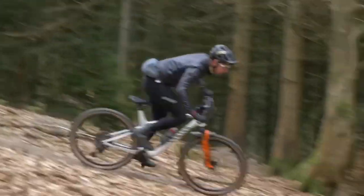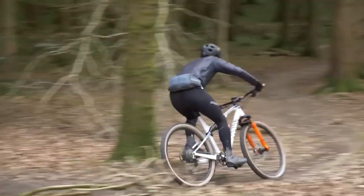In winter you ride slower and it's all about getting your tire to conform over mud. I find anything from 27 up to 30 psi is a pretty good range for that tire — there's enough support so it doesn't roll around too much and it holds its shape well. Something people don't discuss is that on super thin cross-country tires, you get so much deforming of the casing — they're so supple — that it feels like you're running a lower pressure than you actually are. If you're concerned about the pressures, you could go lower and try running inserts for more support and protection, though this does defeat the purpose of going for a lighter tire.